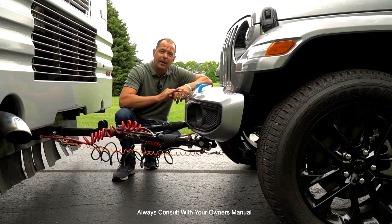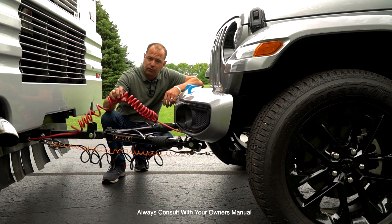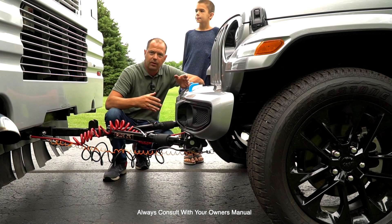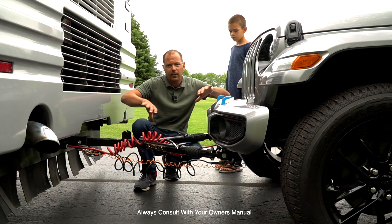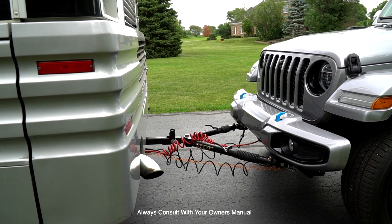I have an RVI battery charger in this vehicle being charged through the umbilical cord. When the RVI braking system uses power from the Jeep, it's being replenished through the RV. If you're on short one or two hour trips it's probably not a big deal, but if you're towing 1,300 to 1,500 miles, I like having the charger so you get to your destination and never worry about a dead battery. Now let's pull forward — you're going to watch this stretch out and hear it lock. The Jeep is still on a downhill in the driveway so it may take until we get out of the driveway for it to go into the locking position.